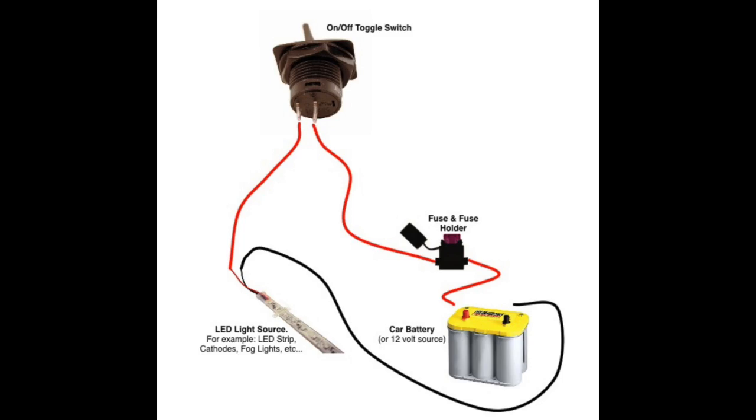The orange battery dimensions — this is a 19.2 amp-hour; Greenway also makes a 15 amp-hour, and I think dimensions are pretty close. This one was nine and a half inches by five and a half by two and three-quarter inches. One thing I didn't show that I wish I had was wiring the switch — I'll drop a diagram here, it's super easy. I'm a fireman and I can wire the switch, so you can too. I wired it back to the original switch location on the case. The speed test result: we got 21.8 miles per hour and I'm 190 pounds, so if your kid or your wife weighs less than that, you'll probably get better speeds.